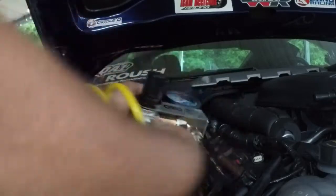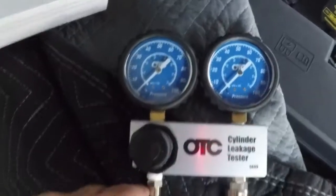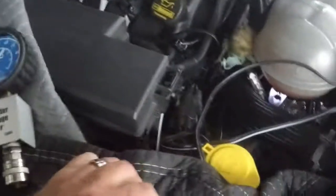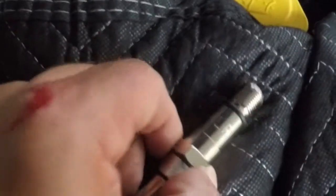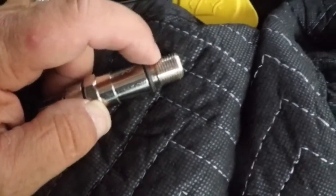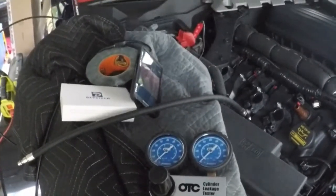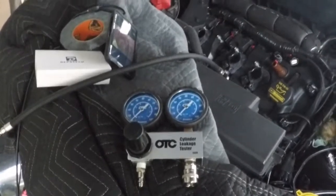The big thing is comparing it to all the cylinders. All my cylinders are pretty consistent — this is the weakest one I had. This is a good test to do before you have an issue, so you know what your car's baseline is. You can get a leak down gauge from Summit, Jegs, or wherever. I did have to get an adapter, because our spark plug hole threads don't start right at the top — they go down a little bit, probably to help people from cross-threading them. So you need what they call a long reach. Remember, when you turn the engine clockwise, the intake valve chases the piston — it'll go down and back up, and when the piston comes up, that's the compression stroke. This procedure won't work if you're following the exhaust valve.